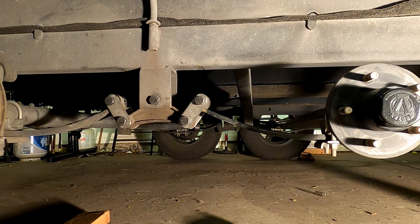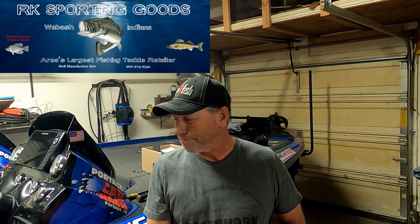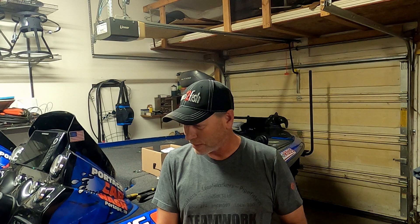All new bushings, all new bolts, all new shackles - the whole spiel. I hope this helps guys. All in all, once you find everything, I'd say about an hour to an hour and a half a side. The next side would go faster - this is the first time I've ever done it. Check both sides after you find the first side. I changed both sides and the total was like $64 for everything. The key tool for me was that three-eighths extension - it fit perfectly to knock all them plastic bushings out. It's a cheap fix, not real expensive on parts. Took a couple hours, maybe two and a half hours total. Hope this helps guys, thanks for watching!